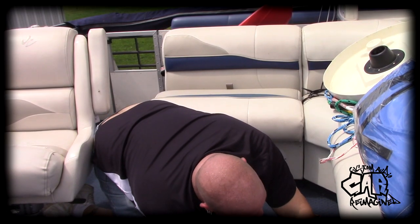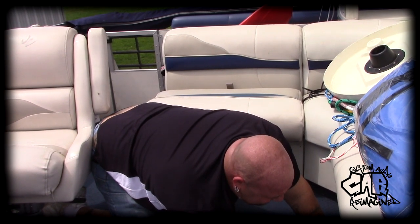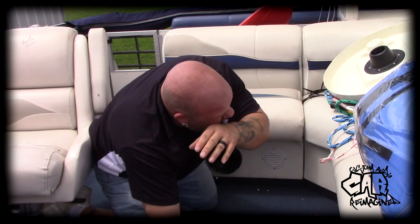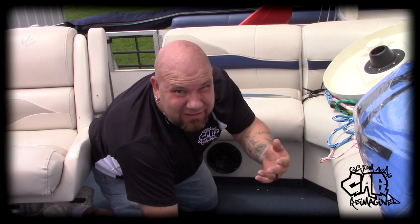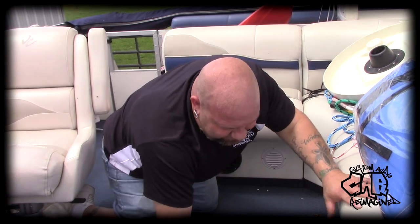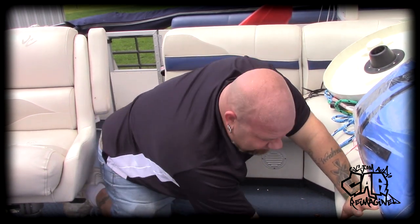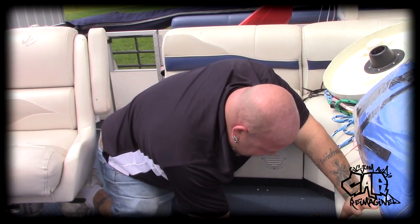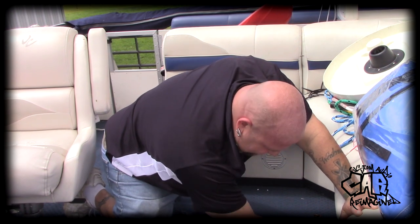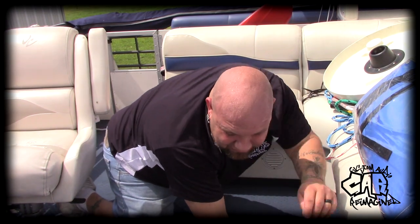When we're done with the install, we're going to need to put some rubber caps over the screws so when people reach in there they don't drag their hand across a screw and cut themselves. There are multiple different ways to do it, but you basically just need to insulate the screws. If you're in a pinch, you can use hot glue — just glue around the threads to a point. Also, pick up your screws because on a boat nobody ever really wears shoes.